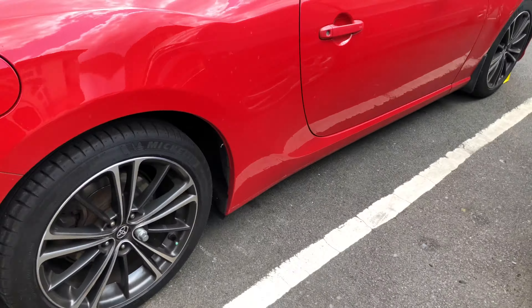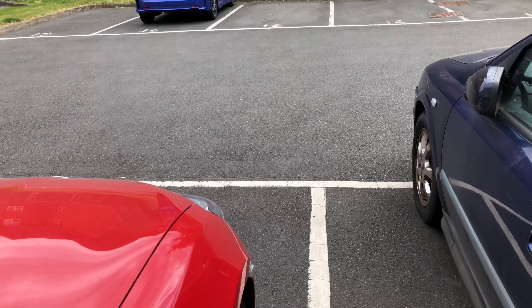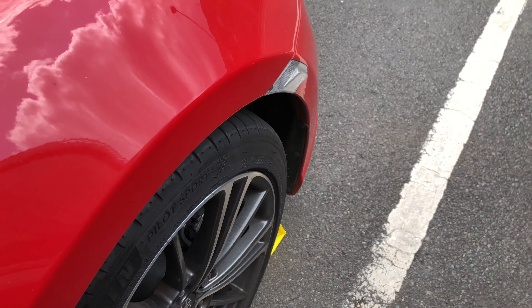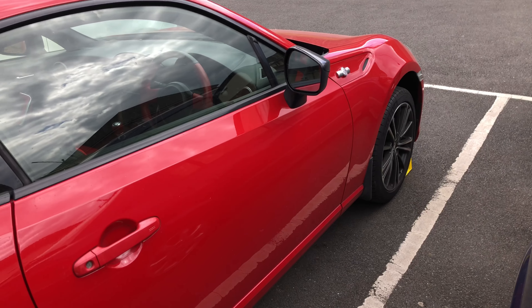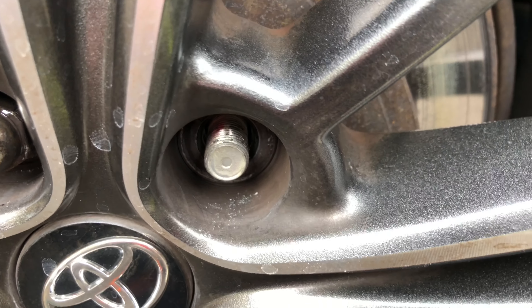I've chocked three of the four wheels. The reason for doing this is when we jack the rear wheel up, the front wheels are just going to be freewheeling. I'm parking on a slight incline — this is my only option, so the road kind of goes down both ways. I was quite worried the car might roll forward, but the rear right wheel is now off the ground and the car isn't rolling forward, which is a good start.